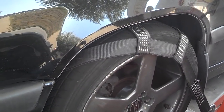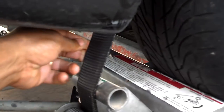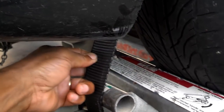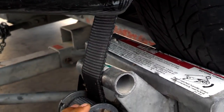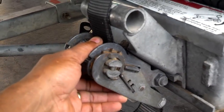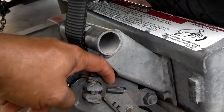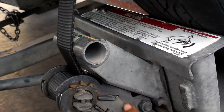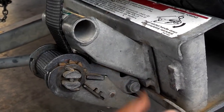These straps are tie-down straps — they can hold probably 10,000 pounds a piece. But since it's a material, it stretches, so you want to come under here and see if you've got any slack. This is my third or fourth time checking them, and this is the first time I don't have any slack. But if you've got slack, you need to pull this and ratchet it a couple times to tighten it. When you've got it ratcheted, it locks on these teeth, and when you close that back, make sure the tip of that hook is all the way up there — that locks it in place. I'm going to go ahead and check the other side.